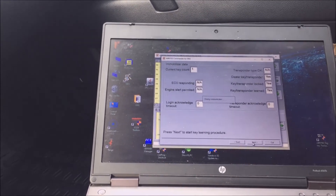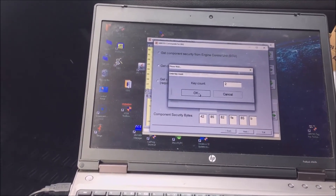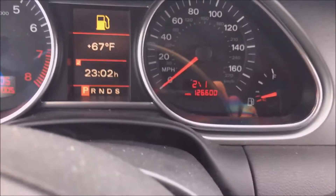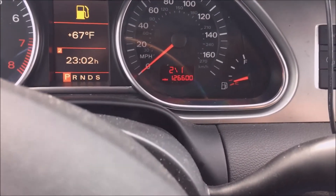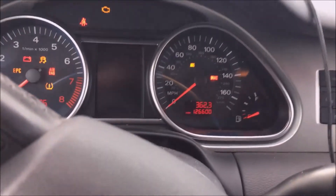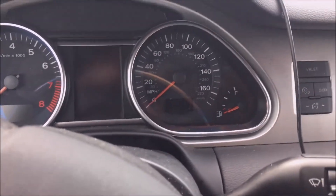Okay, so now we're going to click Next. We're going to make our key count two — that's the old and the new — and it'll tell you what to do. Now if you notice, see the steering lock or the cluster — see how it says two and one. So basically it accepted the original key. Now we're going to take this one, put it in there, and turn it to the on position. You'll notice how it goes out right here — sometimes it'll say two-dash-two, sometimes it won't.